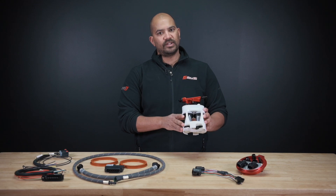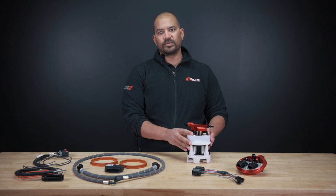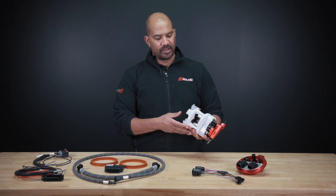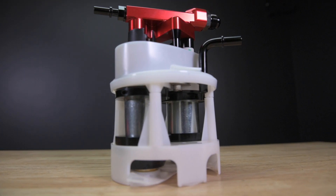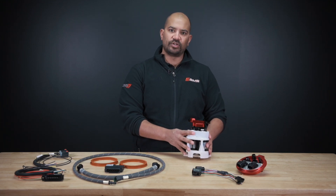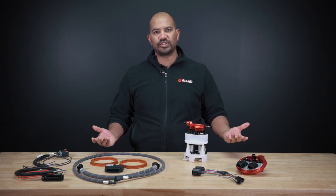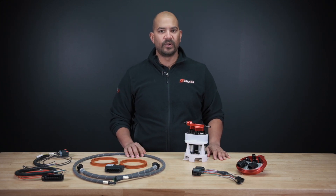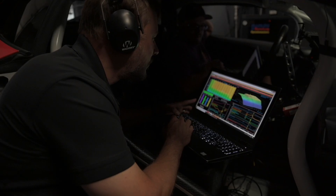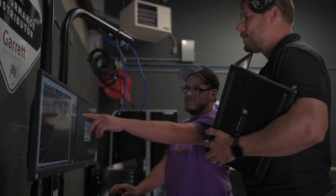This sits in the factory fuel sending unit. We have a very nice little 3D printed jig to allow you to install the second pump. This was actually kind of designed for two pumps, but only had a cutout for one. So a pretty simple little notch and you've got two pumps. These are the same brushless fuel pumps that we use in our GTR dual brushless system, so we've been working with these pumps and the controller for a pretty long time.